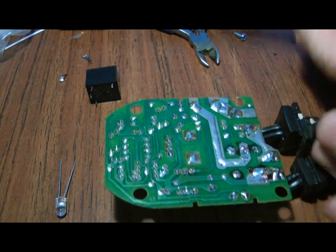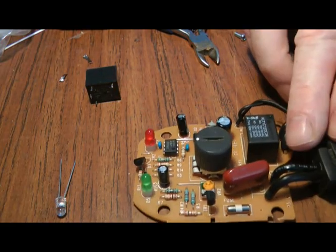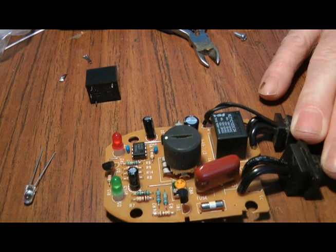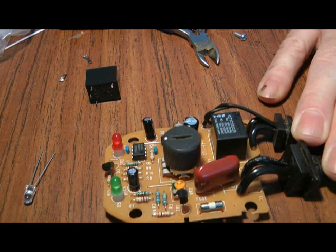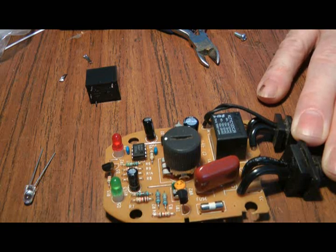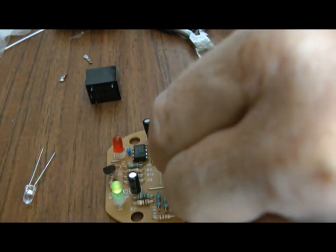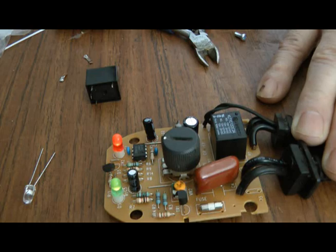Once you've got two points soldered in, it's anchored and it won't fall out. That's another problem — it will tend to fall out before you get solder in. This is the one that had a lot of solder on it, now it doesn't want to take solder. Here's the fourth one and the fifth one. Now, if you want to — and it's usually a good idea, but you've got to be careful because we've got it out of the plastic box, which is a safety shell obviously — plug it back in. It's going to be live so you need to be careful here. We've got the green light, red light — hear the clicking? Okay, we're clicking. The relay contacts are obviously good because we just changed it, so this will probably last for about another two years. They're kind of expensive, so to buy basically six or seven dollars worth of material, pop it open, put in a relay — it's probably worth it if you're able to do that.